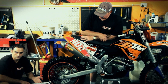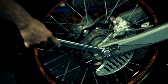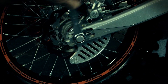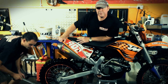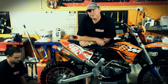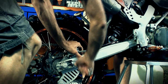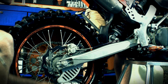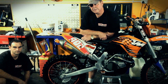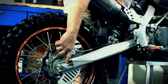What Vinnie is going to do now is loosen the main axle bolt with his number 27 wrench — just sufficient that the axle is loose from the wheel. Then he can proceed to loosen the number 13 locking nut, and he will duplicate that on the other side, loosening the number 13 locking nut so that he can now start adjusting the chain tensioner bolts.